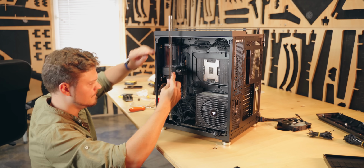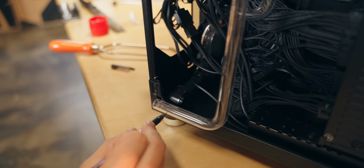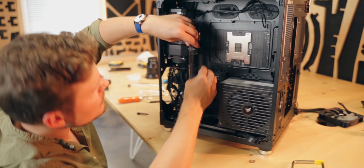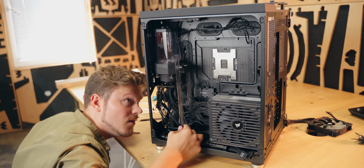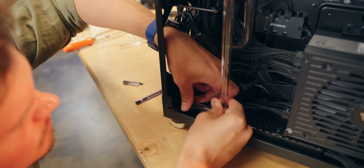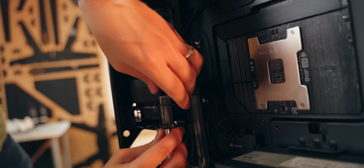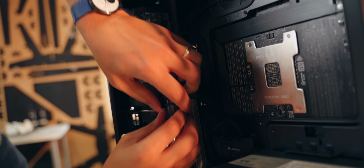And then I was all on my own, seeing where the bend needs to happen, cutting the tube, measuring again on the opposite end, cut and fit, and you just keep going until it's a perfect alignment. Once you're 100% satisfied with it, you move on to the next tube. Now the area behind the motherboard is normally done with soft tubing, but it was great practice before we get into the main section with GPU tubes, as those were the most challenging.